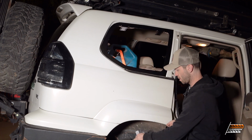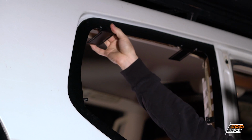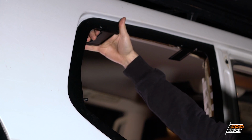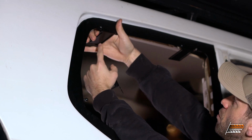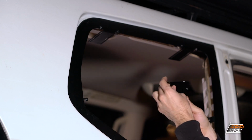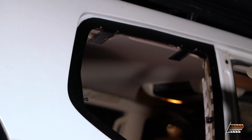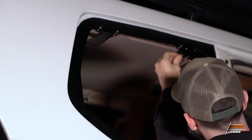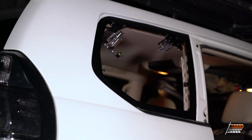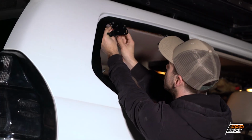What we're gonna do now is, I got all the hardware here. We got these 2 brackets, right? They need to go up here and sandwich the top frame for the latch, or sorry, the hinge that goes here. And you're gonna wanna make sure that you install all 4 of the hinge bolts loosely before you tighten these down, because they walk like this and it's hard to see, but there's slots and it's really difficult to line them up if you haven't done that. So that's the method we're gonna use. It is a little bit finicky getting this stuff all lined up, I will not lie.